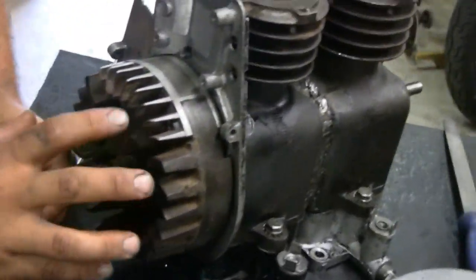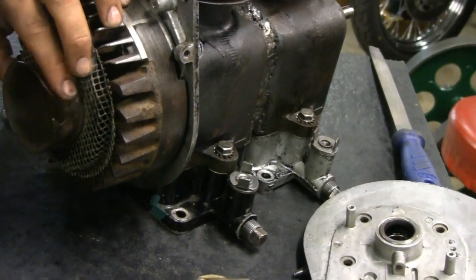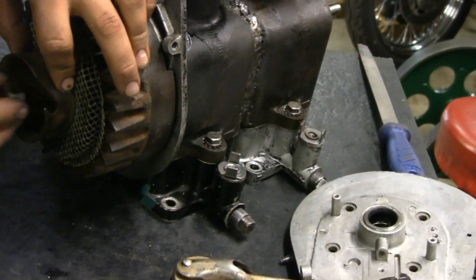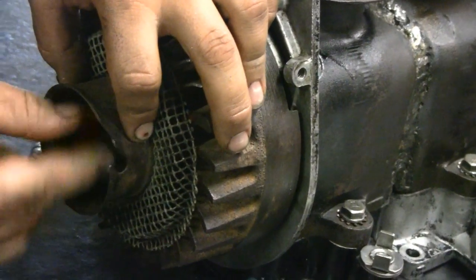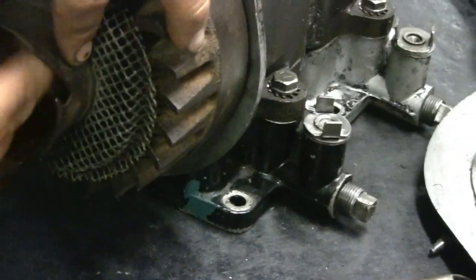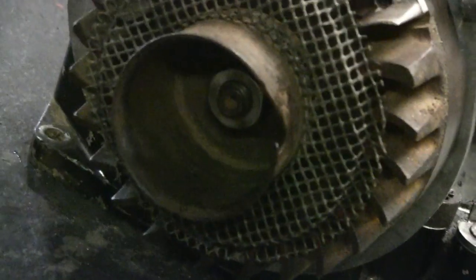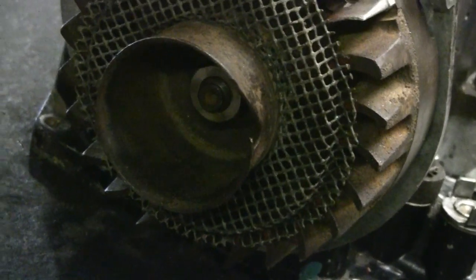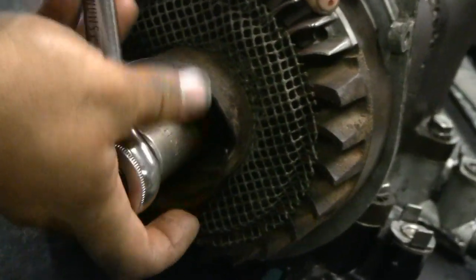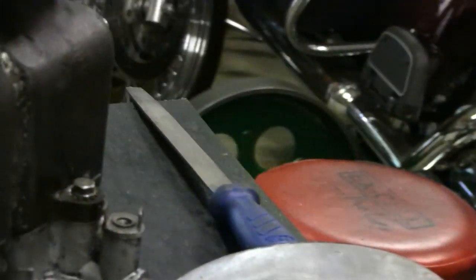Got the flywheel on. Now you got to put the — what do you call that, a cup? The rope cup starter cup. So you have a half inch shaft on there for the nut, and it's a reverse thread. And if it's five-eighths, that's a standard thread. I was wondering when they started and stopped that — I couldn't figure out what year, just the shaft sizes.